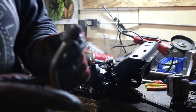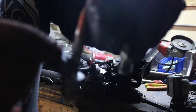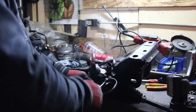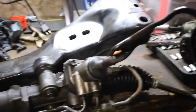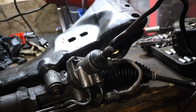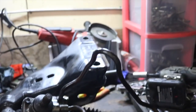This is really cool. What I think JD did is he bought a dash-8 AN fitting — stainless, I believe — welded it on, and then whatever the excess was he probably drilled it out. That's the new subframe. I'll just have to buy two dash-8 push lock fittings with some push lock hose, and see if I have to buy an Earl's power steering line with two fittings and some line. I'll have to see if I can make this line work somehow — definitely have to unbend it somehow.